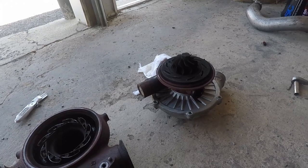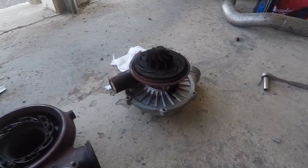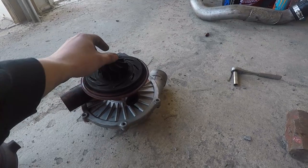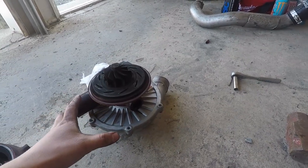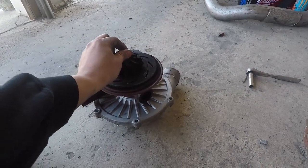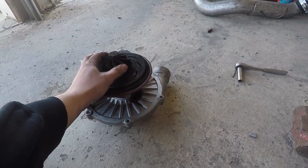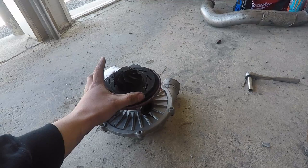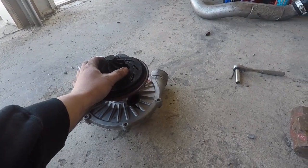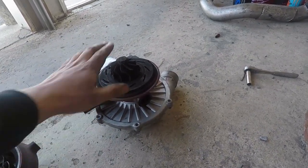So we have the turbo here. We got it all apart and honestly everything looks good. The big thing with these that everyone asks about regarding failure is in-and-out shaft play. All you have to do is take the intake off, get to the front, and just pull in and out. There's no play here - this turbo is fine. Everyone wants to check up-and-down play, but the only way to do that is if there's actual oil pressure in the bearings holding everything how it's supposed to be, so you can't really check that. In-and-out is what you want to check for shaft play, and this has none. We're good there.